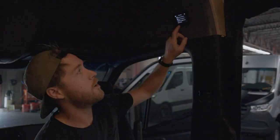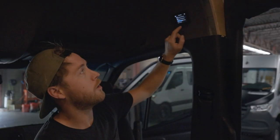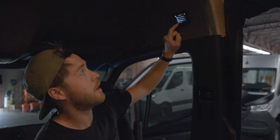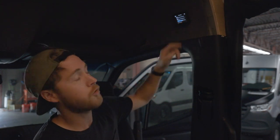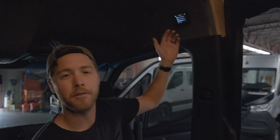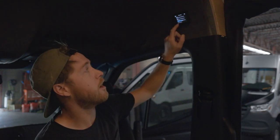On this screen you'll have your working time. We ship the van with the setting to unlimited so this will just run forever. If you want a safety shutoff, you can unselect unlimited and change your days, hours, and minutes. For example, set at 40 minutes, if you turn the heater on it will automatically shut off in 40 minutes — handy if you go to sleep and want it to turn off later in the night.